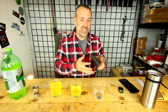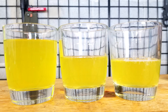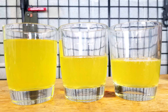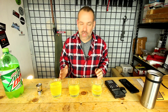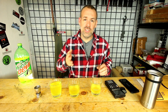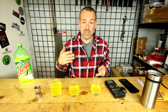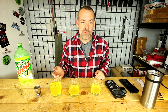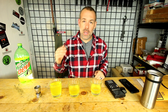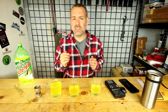Let's measure out that 22 to one compression ratio — that is right at a shade over three ounces, 3.07. So I'm just going to give it three. There we have it right there. It doesn't look like a lot of difference between the 22 to one and 17 to one, but a little bit goes a long way. Now, the compression ratio of the Deuce and a Half is also usually the downfall of the engine. They usually don't wear out — everything with moving parts will wear out eventually — but the downfall isn't that it wears out; it's that some knucklehead gets behind the wheel and puts the thing in the red line the entire time. Yes, it can be driven at 65 miles an hour all day long, and it will take that for a while, but that incredible compression ratio — the engine wasn't really designed to be at high RPM. That's just hammering against all the rods and bearings. You don't want to lug the engine either. You want to keep it somewhere between 1300 RPM and 2200 RPM basically.